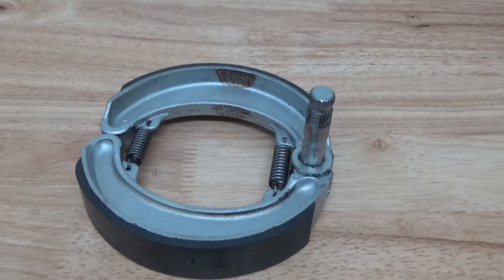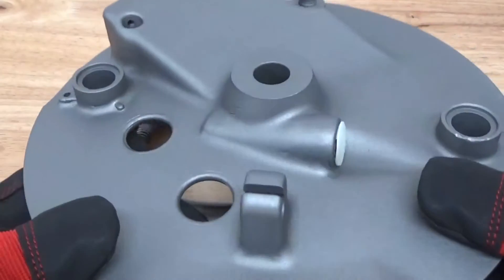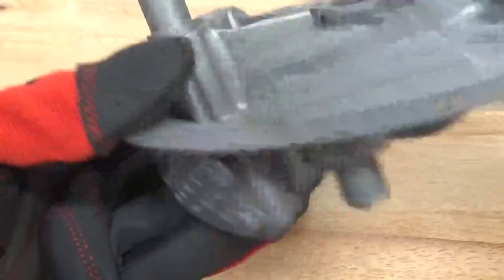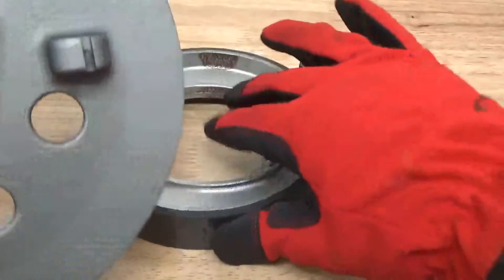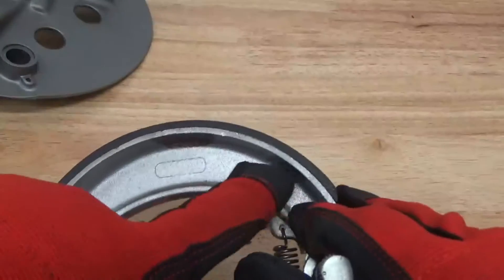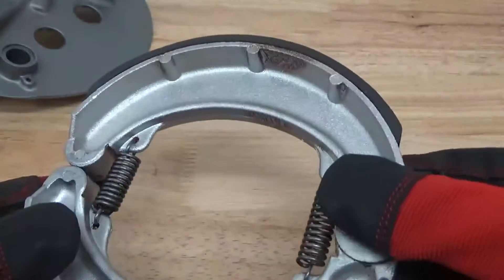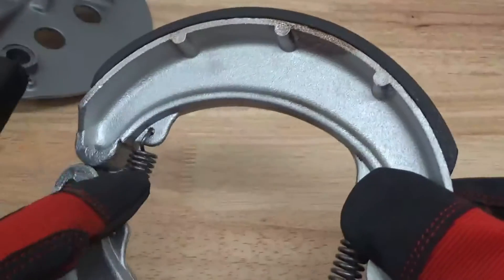If you're prepping for any type of internal engine coating for pistons, or any type of ceramic coatings or external coatings on your engine cases — I have an example here of a hub or wheel hub cover that we coated a few days ago in a thermal dispersant coating, inside and out. This helps get the heat away from the part. It's a light grayish part. What we're doing in this video is prepping this inner aluminum area and the steel shaft for the ceramic coating.